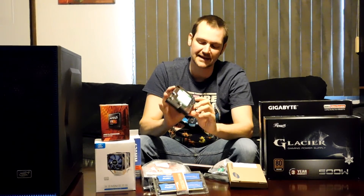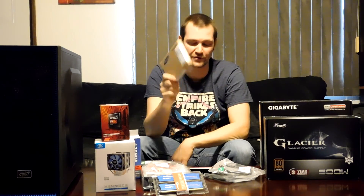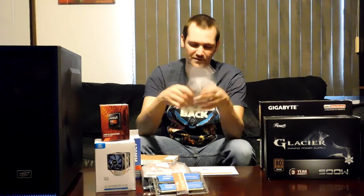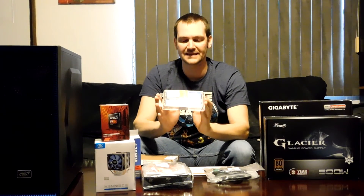For the hard drive, I have a Western Digital 1TB mechanical HDD that I harvested from an old PC, so I didn't pay anything for it. I did buy a 120GB SSD — a non-mechanical hard drive — which speeds up everything with faster load times. My OS will go on the SSD along with a handful of programs, and everything else will be saved to the HDD. I also bought some extra SATA cables for about five bucks off eBay.